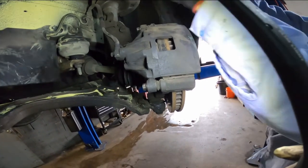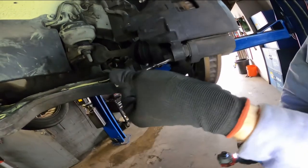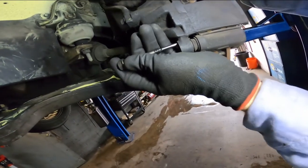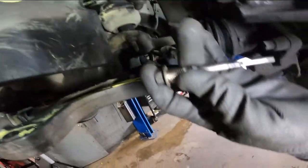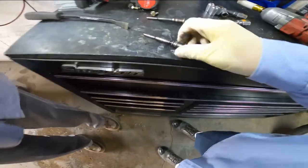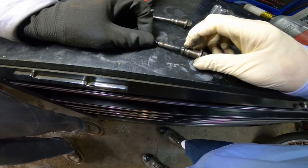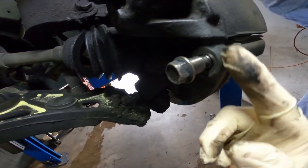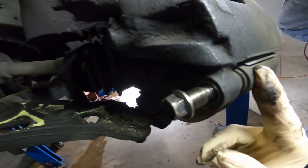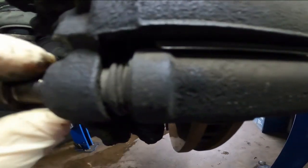We've discussed friction material — one of the big upsells in the brake industry is semi-metallic, ceramic, all these different descriptions of pads. But what we want to look at here are caliper bushings. Before getting into friction material composition, these bushings have little rubber o-rings that go around here. When these o-rings go bad, this allows this portion to contact the metal here. These kits are to rebuild — you're not actually rebuilding the caliper, you're just replacing the caliper pin bushing kits.